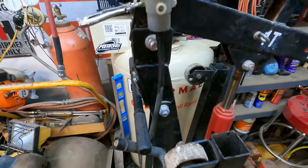So, apparently the vacuum pump method is working. I just got some more air to get out. So, we'll give this a round two. I flipped the whole setup around. Looks like some sort of mad science experiment now. I get all these bubbles, but I think that's because it's pulling air past the bleed screw. Not sure, but it is drawing fluid from the reservoir right now, which is more than it's ever done before.